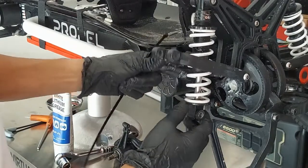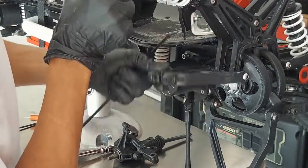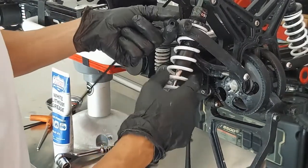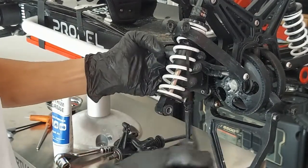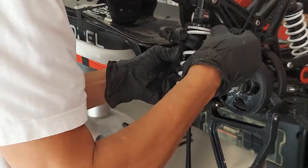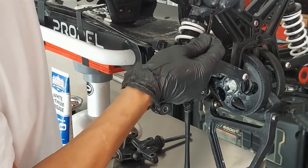The next thing we want to do is get the shocks out of your way. The shock has to be inside the lower control arm when you move them up. If not, when you put the axle in, you won't be able to lower it enough to get the shock in. So put the shock on the inside and get those up and out of the way — not all the way, just enough. I do that with a quick zip tie.